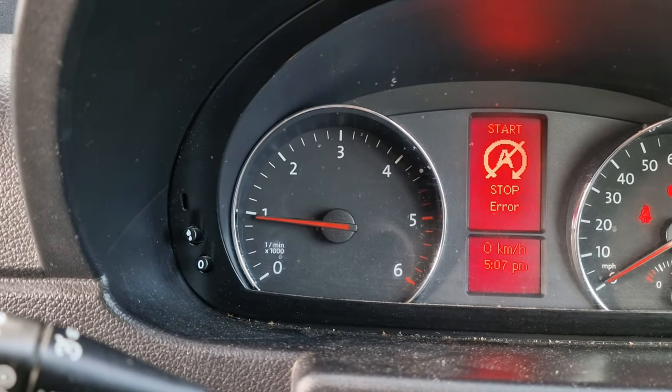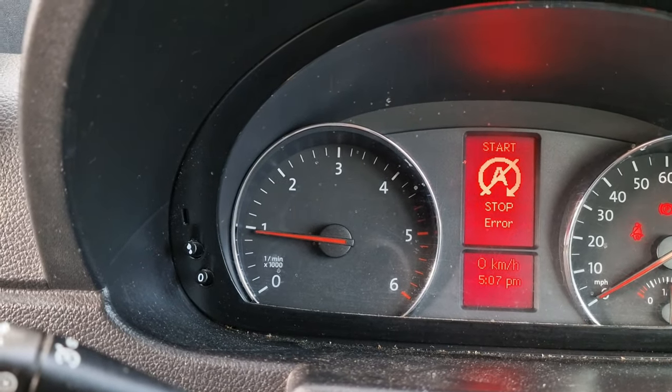Look, a flashing pigtail again. We're back in the cab and we've got yet another flashing pigtail, but this one isn't a surprise. This is the one I was talking about in the last video - the auxiliary pump for the EGR, the EGR recirculating pump that's been playing up, been a bit noisy. I thought it was on its way out. I think by changing the other pump it's highlighted that there's an issue on this one, so we'll check it out on the reader and see what comes back.